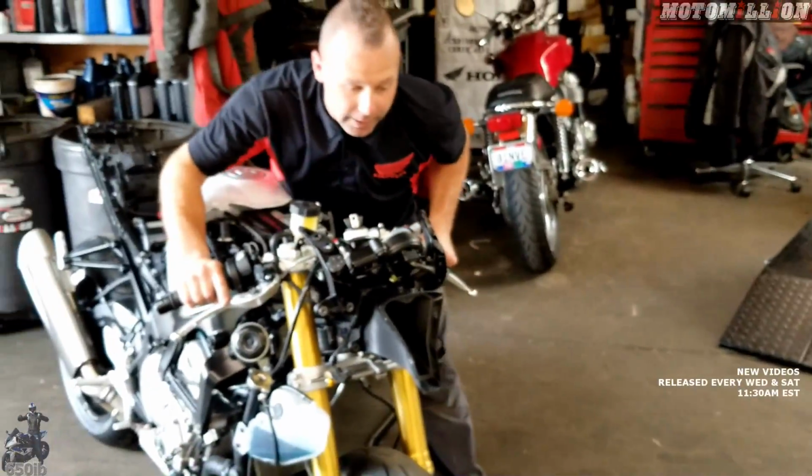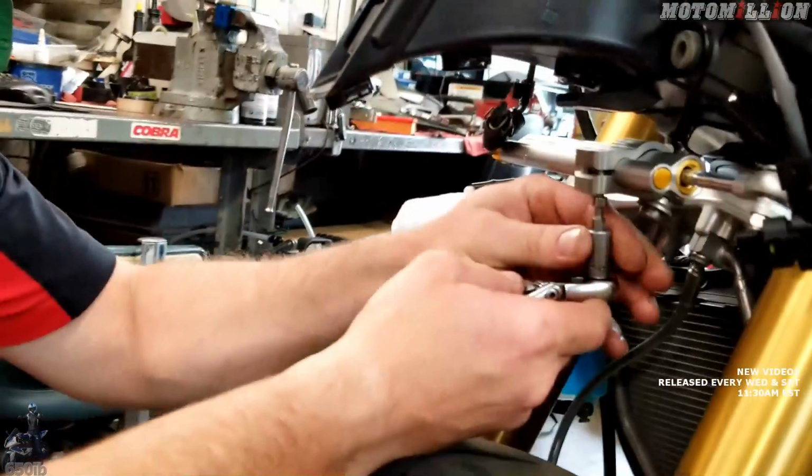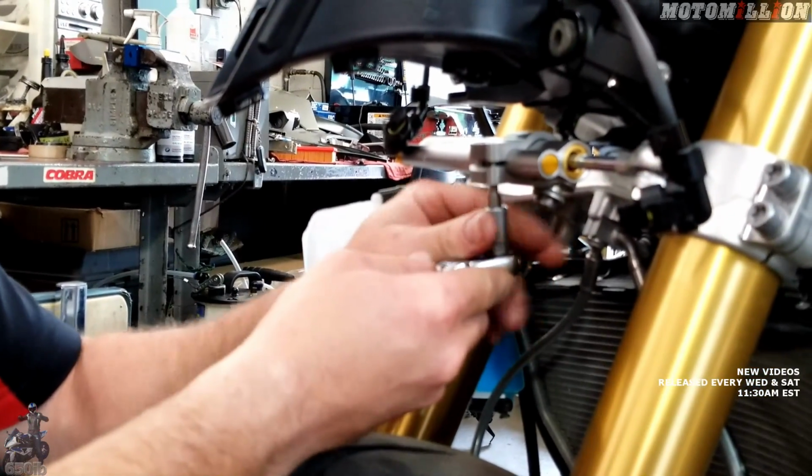So just what you need to check when you're done, so that you don't have any restriction in your steering. That would be bad. And that we know we're good, just pull one bolt out, a little bit of blue Loctite, put it back in. And how do you achieve 6 Newton meters? Just by feel? No, we'll use the small torque wrench.